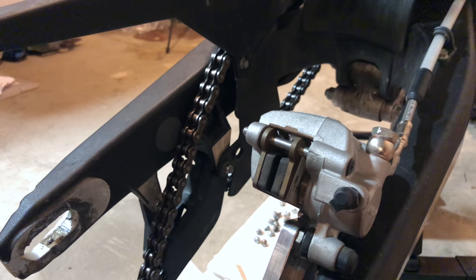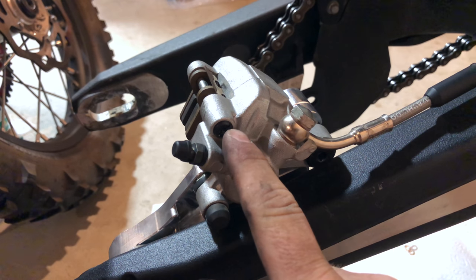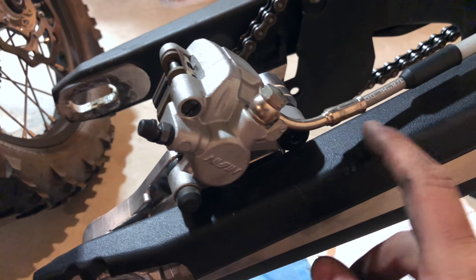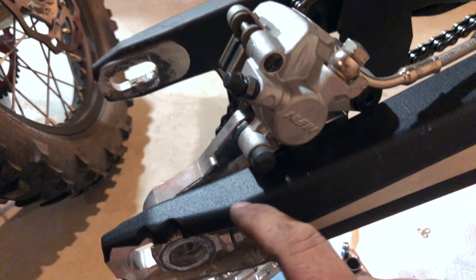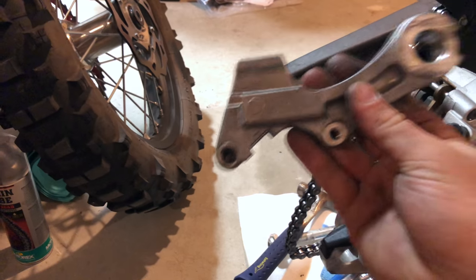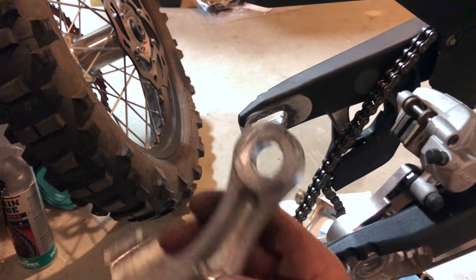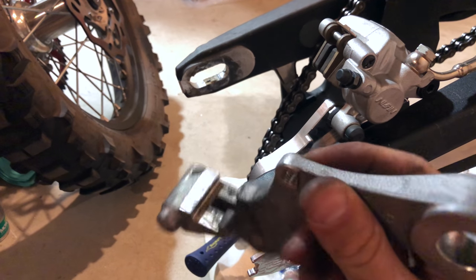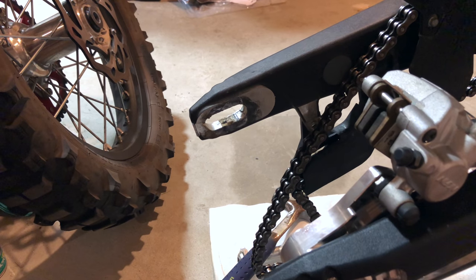There's a little bit of a gap right here, so make sure you do what you can to eliminate that gap so you're not getting any crap in there. Before you put the wheel back on, here's the finished product. In short: flat head screwdriver, backed by a five millimeter Allen, pull the pads, unscrew and pull the caliper off. Once you remove the wheel, you can yank the OEM carrier right off. Remove the nut and the rear slide carrier, then transfer it over to the shark fin, and move the pad carrier over to the EE as well.